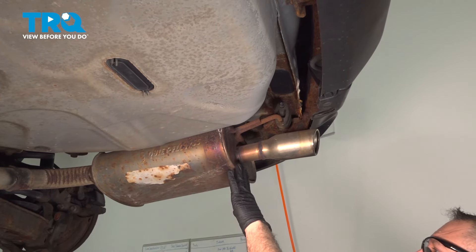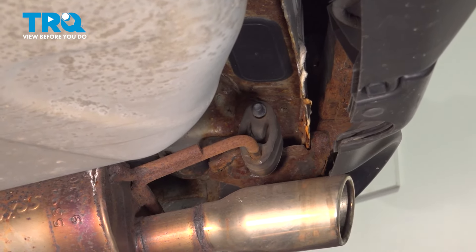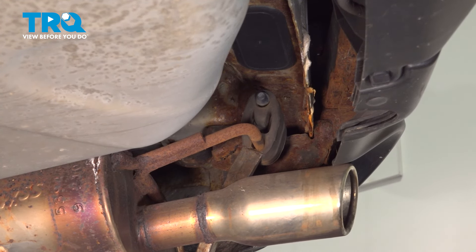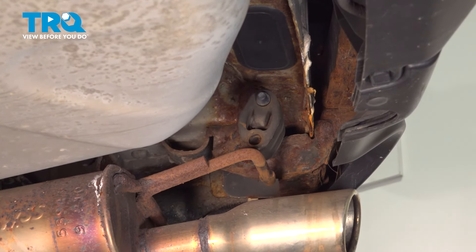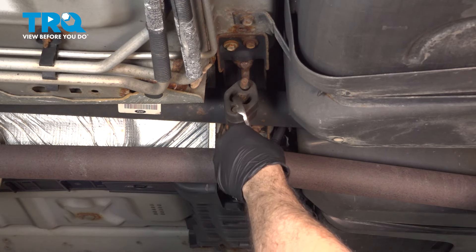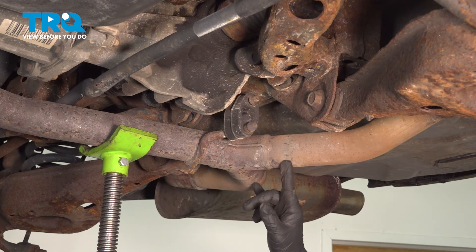Underneath the rear of the vehicle, you're going to locate two mufflers — one on the passenger side, one on the driver's side — supported by some rubber hangers. There's one here, one on the other side, and one in the center. We're going to use a pry bar up against the bottom and the muffler tip to pry that off. We'll use channel locks on the central hanger, and a small pry bar with a twist to get in there. We have our rear hanger just before where the pipe splits off to a Y.